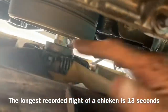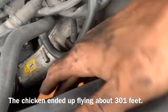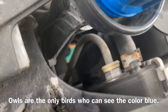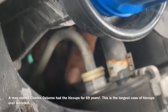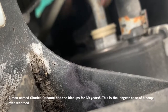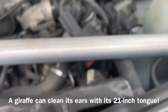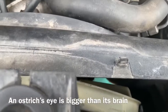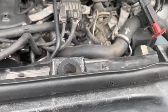We don't totally need to unhook the fan — we just need to unscrew it and move it to the top of the engine. Reaching down along the side, we're going to release the fan shroud: put your finger there, push up on it, and with your other two fingers pull up on the fan shroud to release it. We do the exact same procedure on the opposite side. Once it's loose, we can lift up the fan blade at the same time as we lift the fan shroud and pull the shroud out of the way.